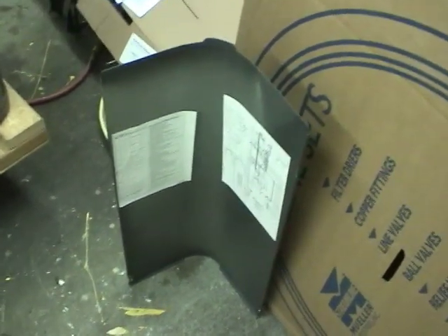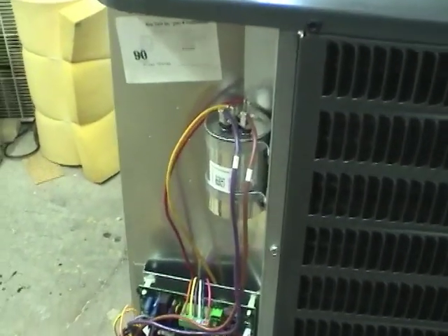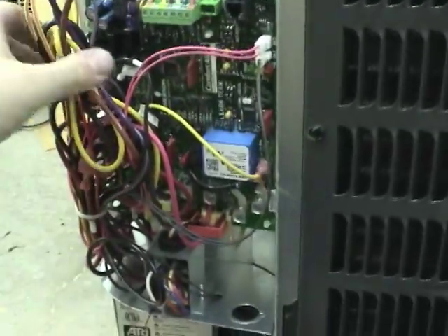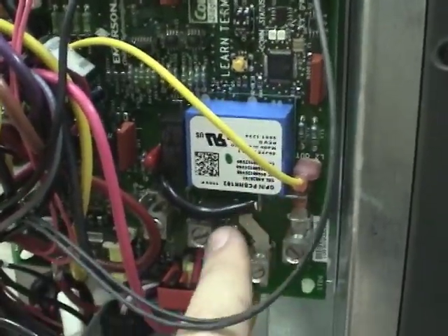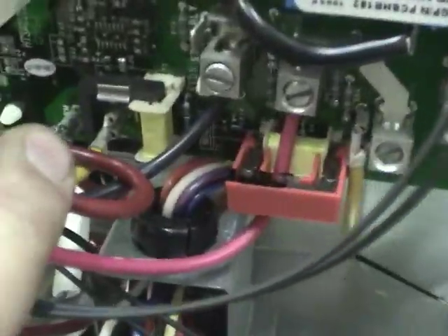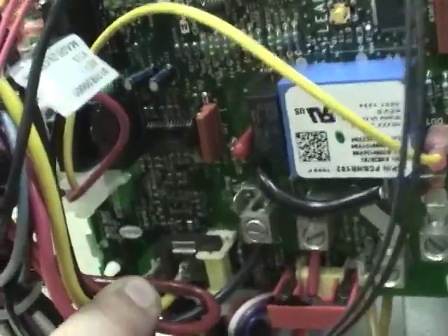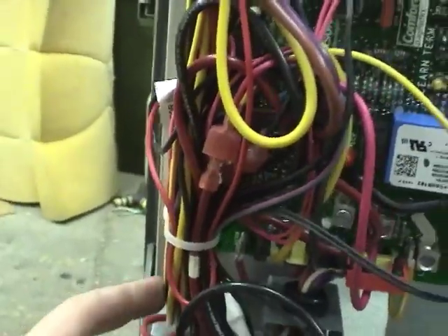Since I'm out here I thought I may as well take off the cover panel. There's not much in there — there's a capacitor for the motor, and the compressor and fan up top, and the PCB that does everything. Looks like the mains connect in here; that's probably the relay for the compressor, and there's one for the fan somewhere. There are current transformers here to measure current draw, so it can shut down if something draws too much.